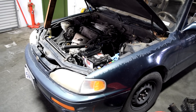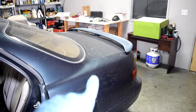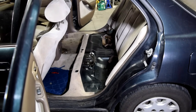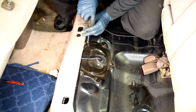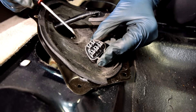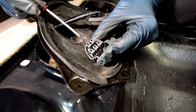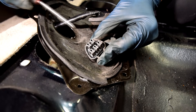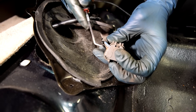After checking the fuse and relay, it's time to go over to the fuel pump and make sure we have power and ground there. On most passenger vehicles, you can access the fuel pump through the bottom of your trunk or by removing the bottom cushion of your rear seats. On this car, we'll also need to remove this top cover by first removing these three Phillips head screws. Here's a look at our connector. If your fuel level sending unit comes as part of your fuel pump assembly, you're going to have a 5-pin connector. Three of these are for your fuel level sending unit; the other two are for power and ground for your fuel pump. You'll need to look into your repair manual to find out which two wires are those.